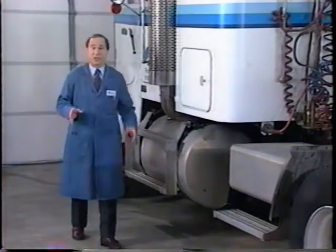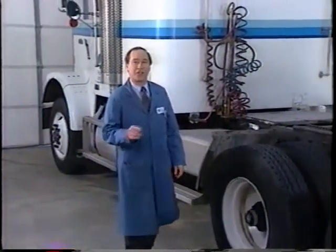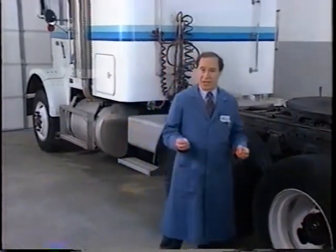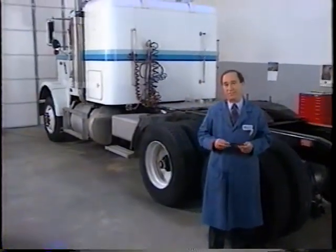In this segment on selecting proper slack adjusters, we'll discuss preliminary safety precautions. Check installation clearance with a template. Determine the size needed for a new slack adjuster, spline size, piston size. And we'll cover the use of the correct installation template.